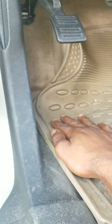Because these plugs pop loose, and there's more than just these two for the sunroof. There's some underneath this area here. If you stick your hand up, there's one actually underneath here. It's pretty high up, but it's not that far where you can't reach it. But it's up there, and you make sure that is plugged in, because if it's not, you'll have a whole bunch of water dripping on your feet.